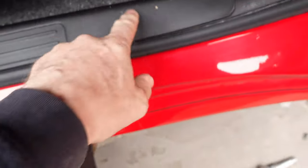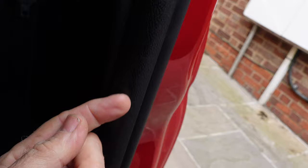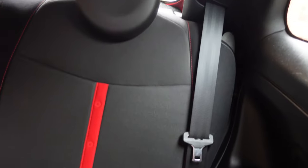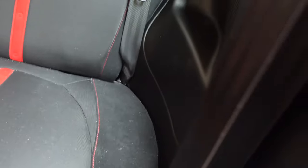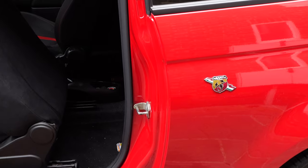Then we have to lift this piece out of the way — there are some screws on that, more screws down there, we have to take the seat belt off, drop the rubber down the side of the door, and take this off. There's a screw in the boot to undo. Once we get all the bolts undone, the pre-tensioner needs to be disconnected. The final bolt is in the corner — a tricky one because they can break. Once that comes out, we pull the panel off; it's on poppers. Let's do it.